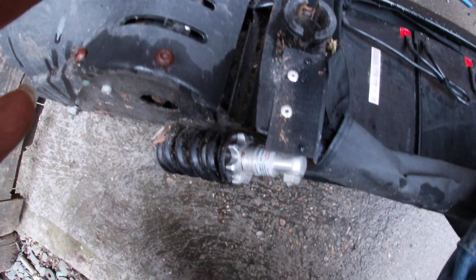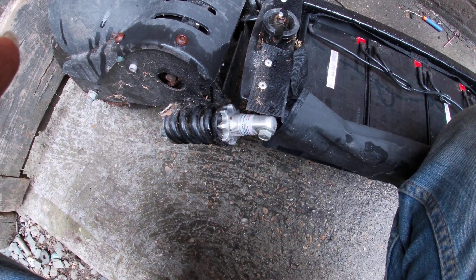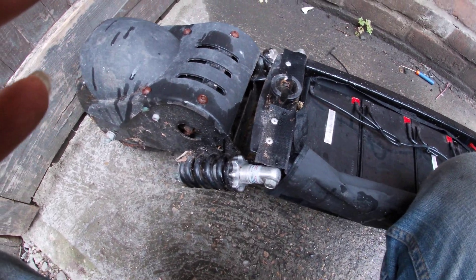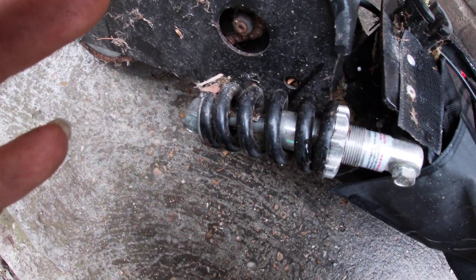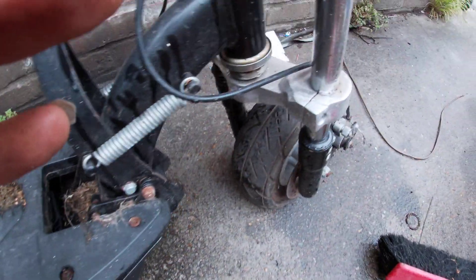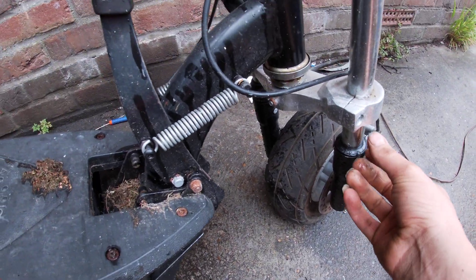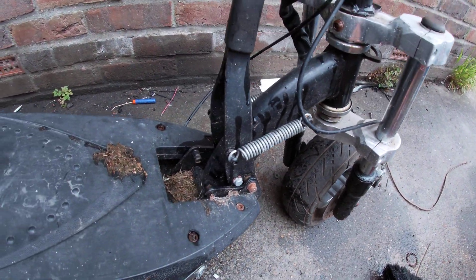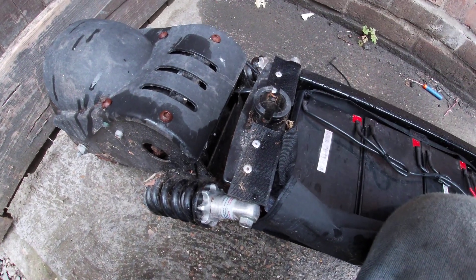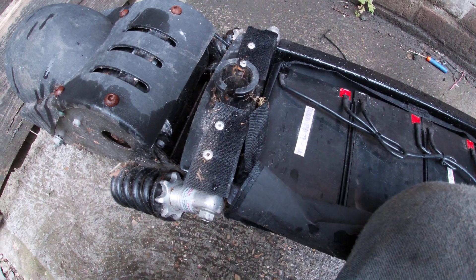The motor in here is an 800-watt 48-volt brushed motor, which is a bit lame, so I might have to upgrade that to brushless. I've already got one of these in the works for a brushless motor, but I haven't got a set of forks for it yet, so I might just drop the brushless motor in here instead. We have dual suspension - I use the term very loosely. These are like the crappiest shocks you've ever come across. The front ones do move, but only about 20mm, so not the best. These things really are not the best quality.